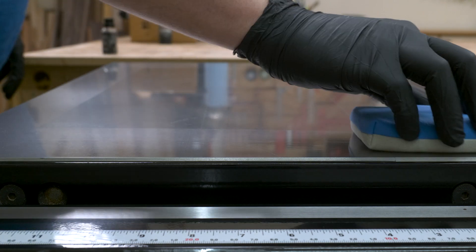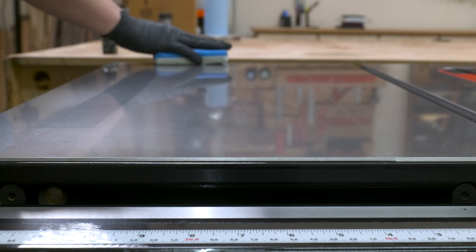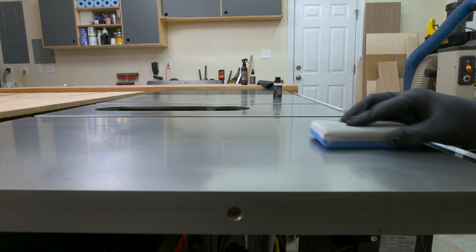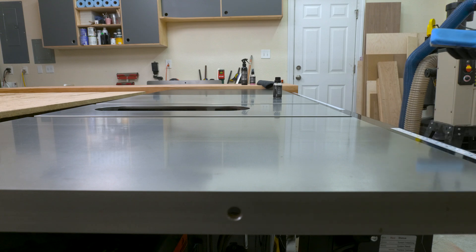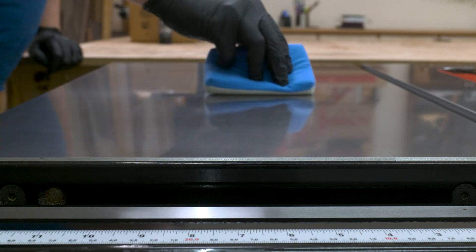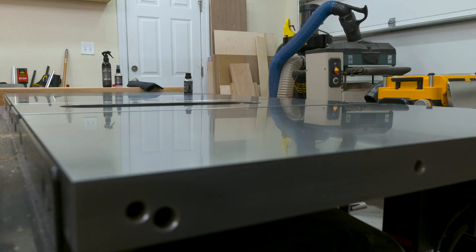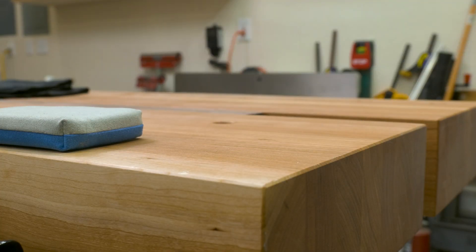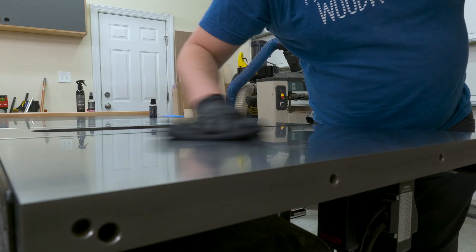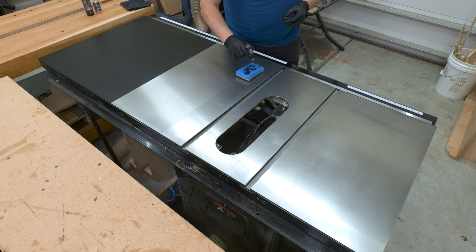To apply the product, first shake it really well to make sure you've distributed the graphene throughout the solution. Put a couple of drops onto the application pad and then use it in a rectangular fashion around your work surface. The first line is what they call the well, which is where the majority of the product exists. Gently work the product across the work surface using the pad flat at first, then wait 60 seconds and work it again with the pad at a 45-degree angle. Wait another 60 seconds, then buff everything out with the clean side of a microfiber towel. Working in smaller sections — they recommend anything under six square feet — gives the product appropriate time to bond to your metal surface.